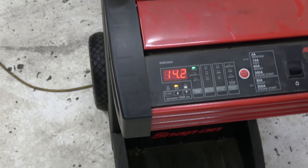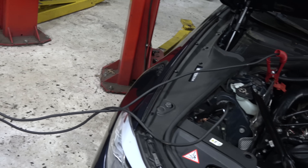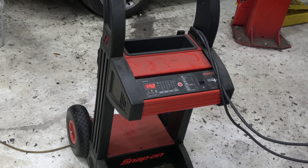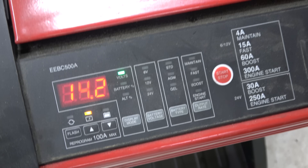You also need a clean power supply. There are various companies that make them — OTC Schumacher, the Snap-on one, and several rebranded ones. You need a good, clean power supply that is going to provide sufficient voltage and amperage for the vehicle you're programming. BMWs are notorious about drawing a lot of amps and a lot of voltage. You've got to have the voltage set high enough with enough amps to support the programming event.